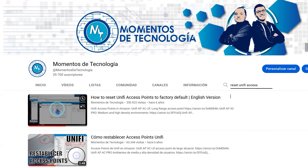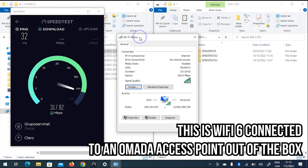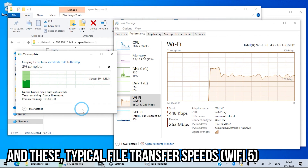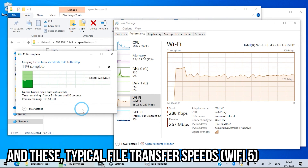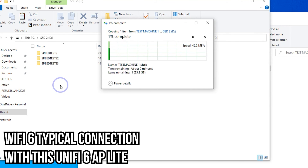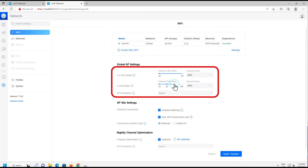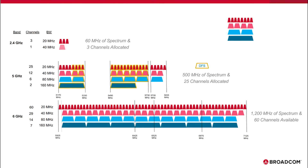After running a few tests and having used them for quite some time, you may compare them with what you may have already seen in our test with Wi-Fi 6 from Omada, where we were able to see how much faster Wi-Fi 6 is compared to Wi-Fi 5. Of course, and this is very important, link speeds are not actual transfer speeds — you may get 500 or 600 Mbps links and actually get 300 or 400 Mbps real transfer speeds. When networking and transferring big or huge files, the benefits are outstanding comparing to Wi-Fi AC Wave 2. Be aware that speeds can be tweaked and maxed out depending on the channel width you configure in your controller; however, it may also have two negative effects: narrowing compatibility with some clients, and being vulnerable to interference in the spectrum specified for that channel.